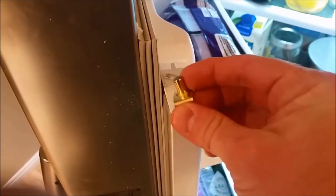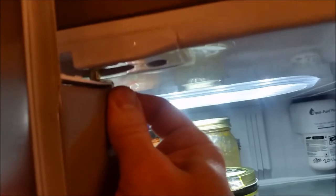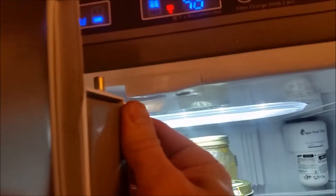I'm going to use this little shelf bracket to replace the little peg that's supposed to stick up here, and it's actually the perfect size. If I stick that in there, you can see it's going to fit in there and then work like the peg did before, automatically closing the mullion like it's supposed to when you open and close the door.